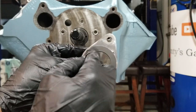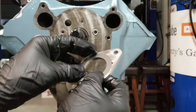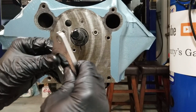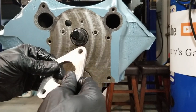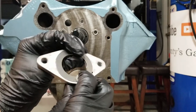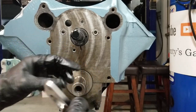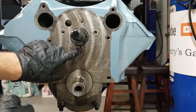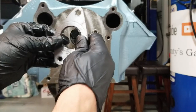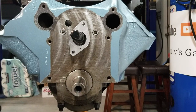This is the solution: it's a fixed bearing — there's a roller bearing on this side and then there's another roller bearing on the cam gear. We're going to go ahead and mount this; it's really simple. We just need to make sure our oil hole lines up with our oiling slot in the block. I'll set this here for a second while I get my blue thread locker.